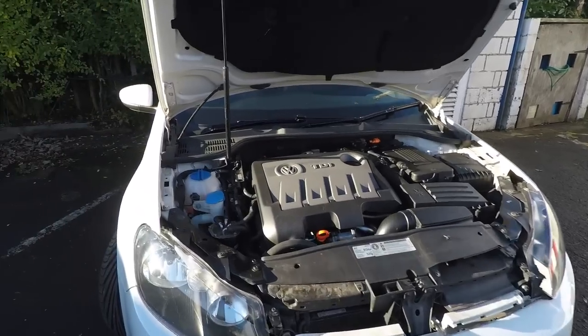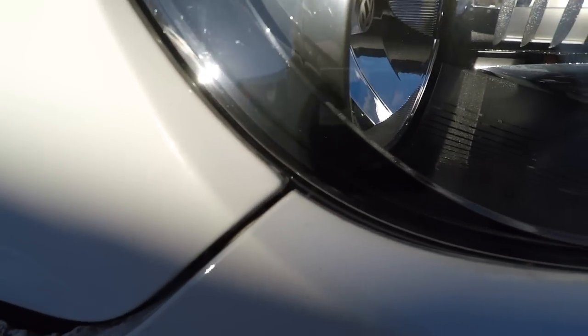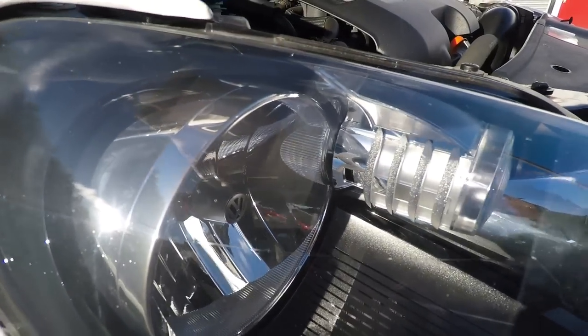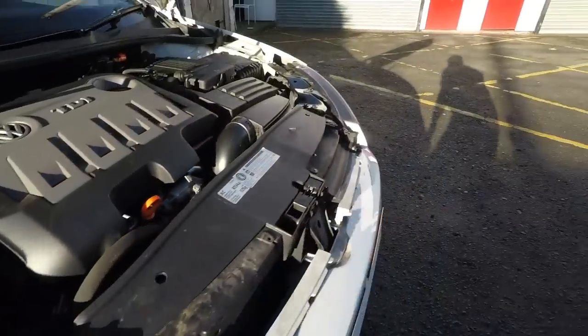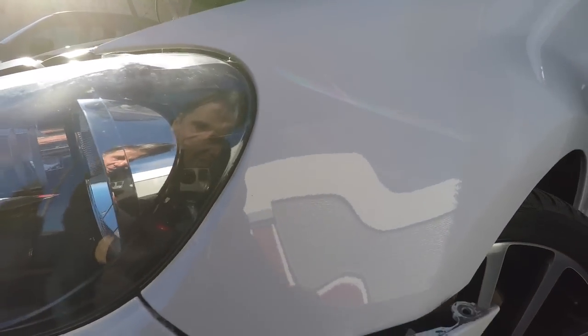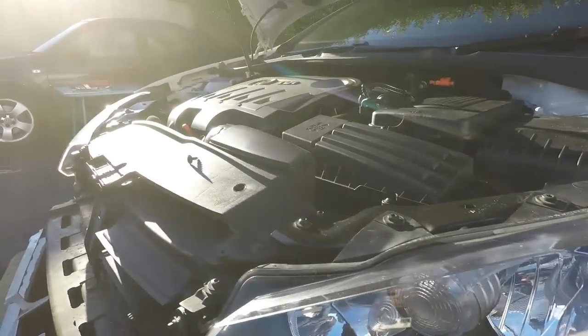So right, I'll begin by trying to pull this corner off. So I've got all the screws out. Now, can you see in there, the bumper's cut so it's got a tab, and the tab locates into a plastic clip that's on the bumper. And if you just pull it, you're just going to rip the plastic. So you really need to encourage it. I tend to just move across to the other side. See if this one's a bit easier, because once you get one end off, yeah, see that one's come off. Right, so the bumper's free.